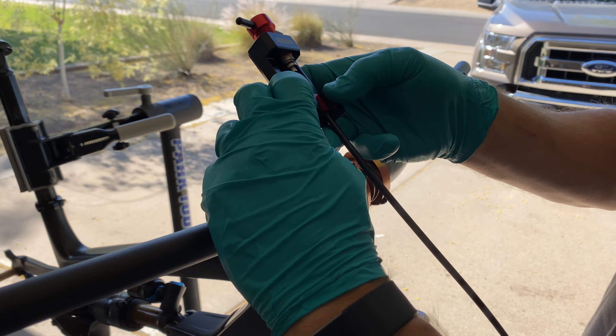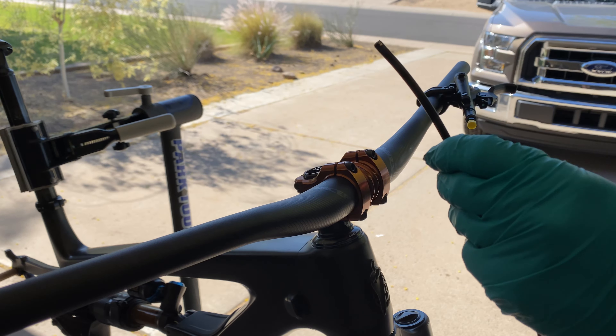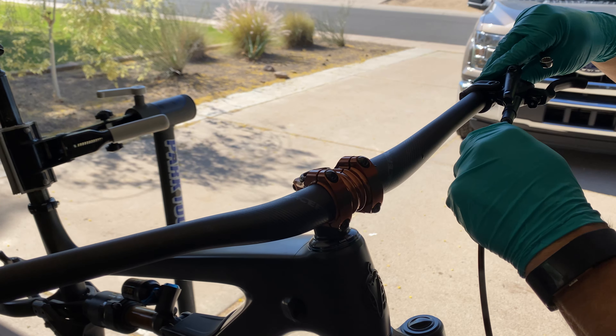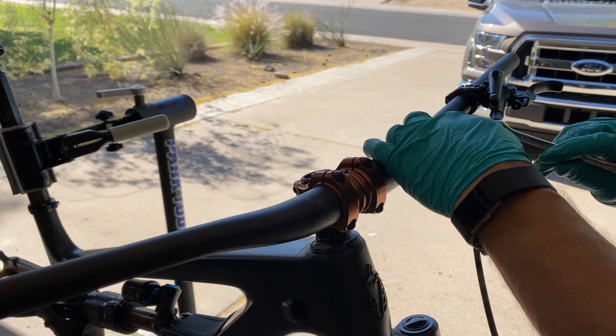This did not work for me. I inserted the hose and it just wouldn't go in all the way. I later discovered that the olive in the brake lever was slightly damaged and it didn't slide onto the edge of the hose. I put it together to prevent any further leaking of mineral oil and later that evening I ordered a new olive and barb set from Shimano.